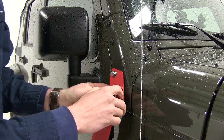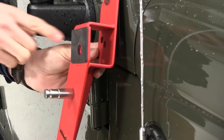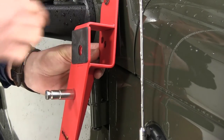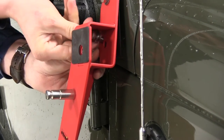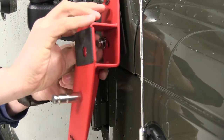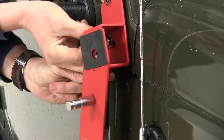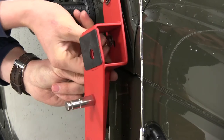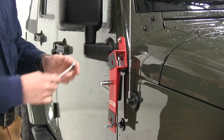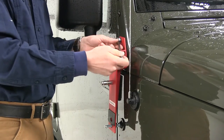We don't want to tighten that down all the way just yet. Go ahead and grab our other hardware and get that started as well. As far as the two holes, you just want to use whatever hole matches up with your Jeep. It's always a good idea to hand tighten first so you can ensure that the threads do match up. The hardware that's included just requires a half inch wrench, so we can go ahead and tighten those down evenly.